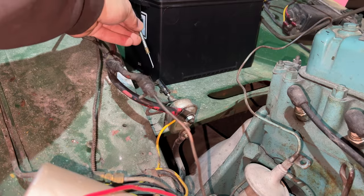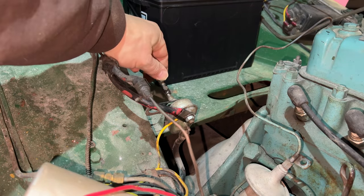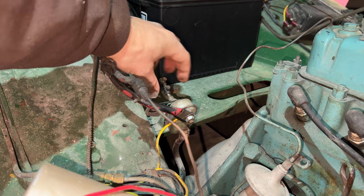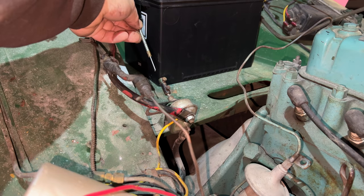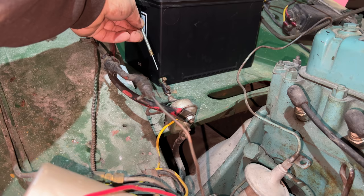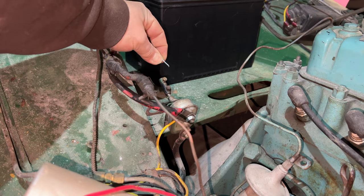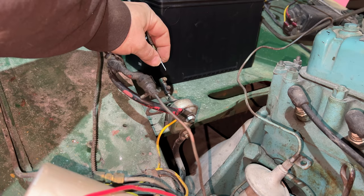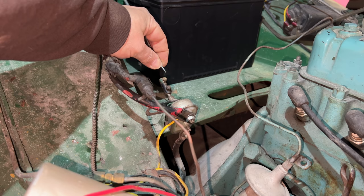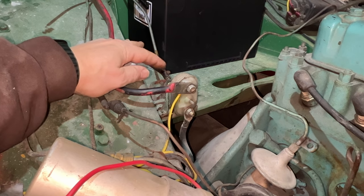On this side of the cable, it is held to the starter solenoid with this device right here. By loosening this and changing where it is tightened onto both the rod and the cable, you can adjust the slack in the starter cable. When adjusting this, you want to make sure your cable is pulled all the way from the dashboard, otherwise there may be slack and your starter cable knob will be sticking out slightly from the dashboard. Now that I have this attached and where I want it, I'll pull the cable and make sure it works.